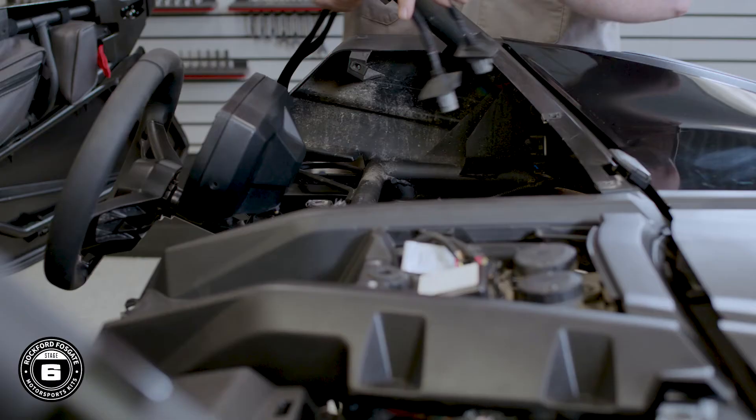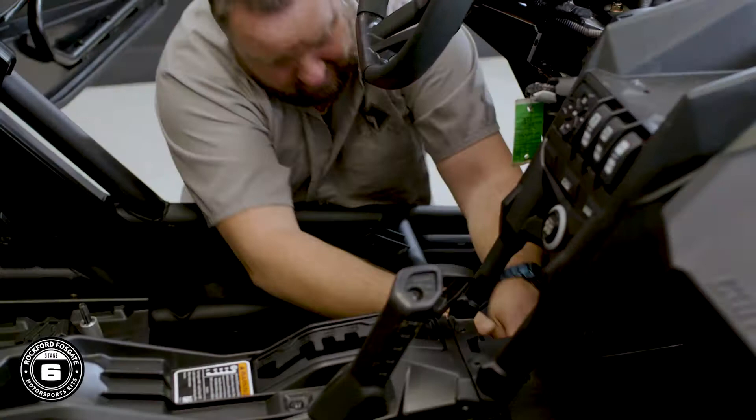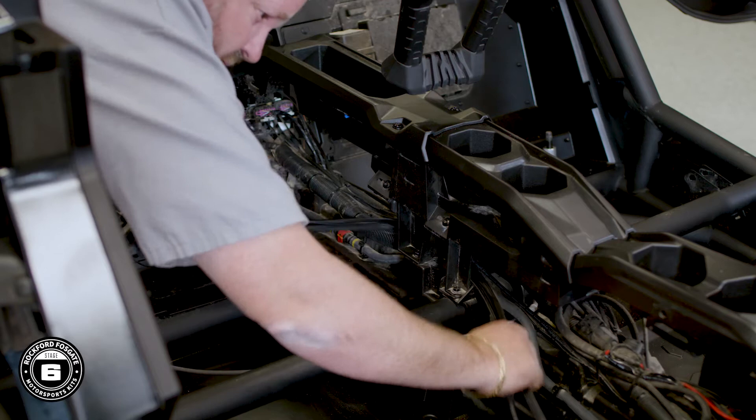The rear cables are designated for the right and left. The red dot is the right or passenger side, so we're going to route the harness from behind the steering column into the center console and feed the cables along the passenger side and access port through the rear firewall. When you exit the rear, make sure to stay away from any hot engine components and suspension.